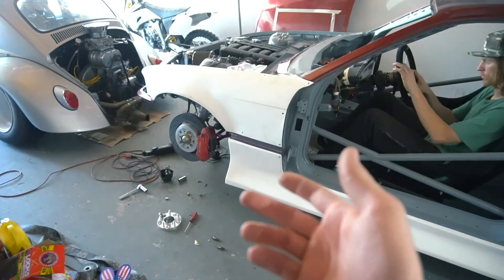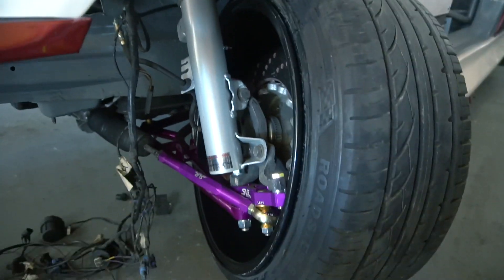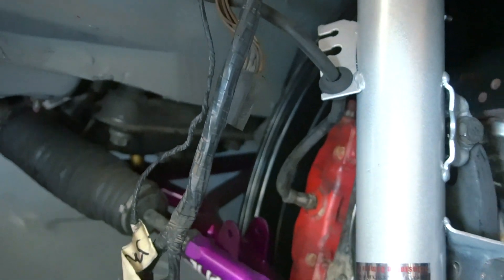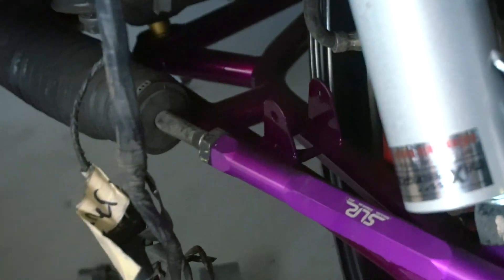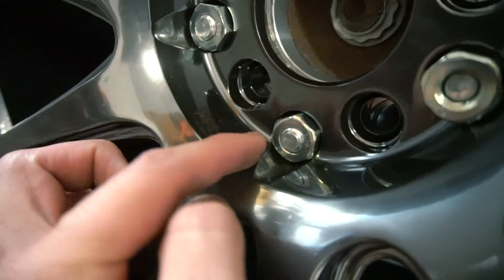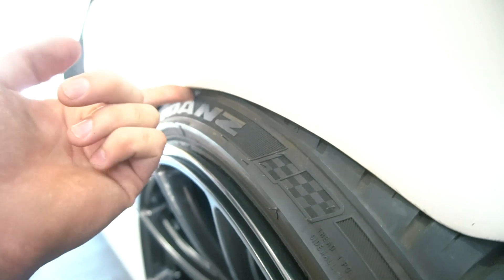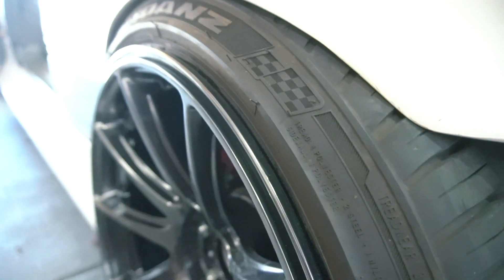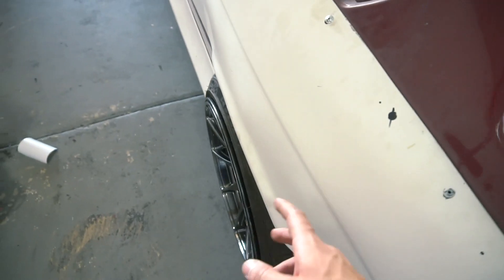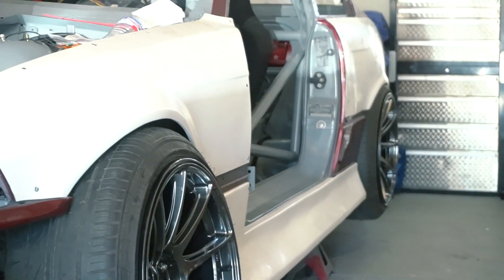That's really all I've been waiting on, so I should be able to finally put the car on the ground today and see it with the new wheels on it. The wheels fit really good. That's max angle right there and the tire is barely rubbing the frame, but I'm going to figure out a bump stop solution — that's right before the caliper hits the arm. The rear fitment is insane. The lug nuts they gave me won't work because I can't get a socket on there. I have to get some deeper lug nuts, but it looks like it's going to be close back there. I probably need to raise it up a little and maybe get a smaller adapter when I order the other ones, since I only got two right now. Dude, it looks so good — the fitment looks so good, the front looks so aggressive.